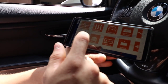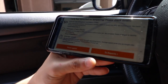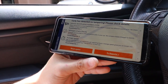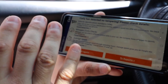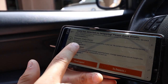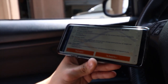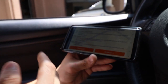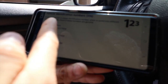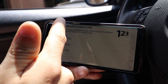Another cool feature that Carly has is the used car feature. This basically lets you know - it's another sort of diagnostic - if you're getting a new car, it lets you know if it's been tampered with or if there are any issues. Right now it lets us know that the VIN is found throughout the car and it's a correct VIN. It also checks the mileage to let us know if it's been tampered with, and shows average speed to indicate how previous owners drove the car. Clicking on one shows us that from the engine to the ignition, the VIN is correct on every single module.